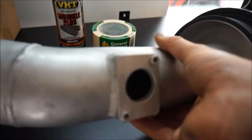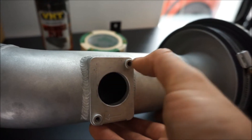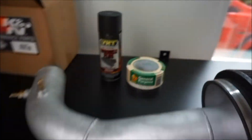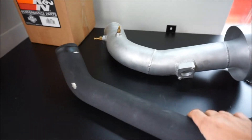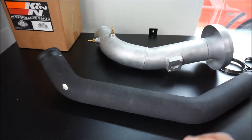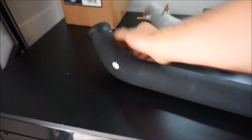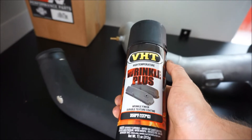I'm gonna leave the bronzy-colored fittings as-is, tape off the velocity intake part, and then we'll start the wrinkle black. Here are the two parts: this is my STM intake pipe, and this is going to be my top mount charge piping. As you can see, some of the old wrinkle black has flaked off. Today's product we're using — not sponsored, but I wish it was — is VHT high temp Wrinkle Plus, 350 degrees.